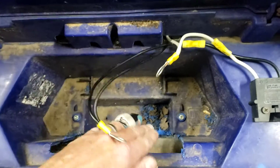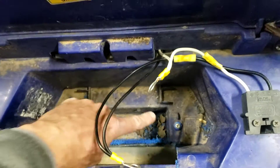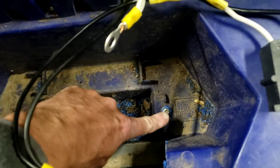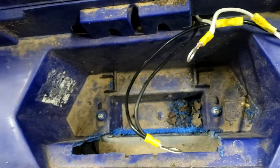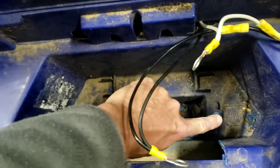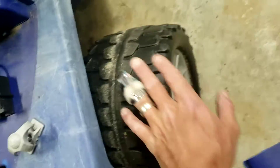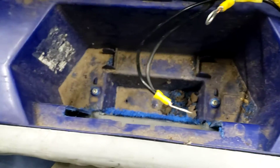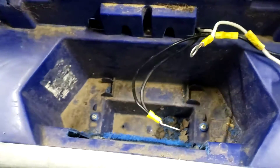There's a white bracket in there that holds the battery from the factory — a little white thing that folds over. There are two screws that hold that white bracket in. On this model, if you have a Jeep, make sure to put those two screws back in because they actually hold the body to part of the little frame piece. So just make sure you get those two screws back in.